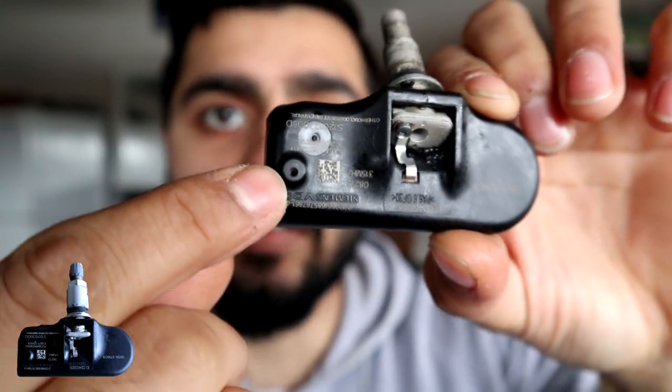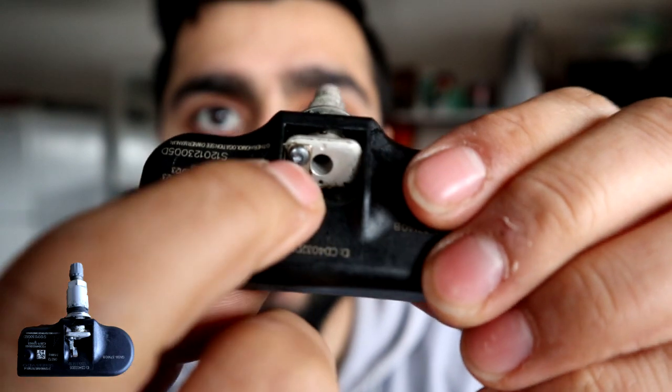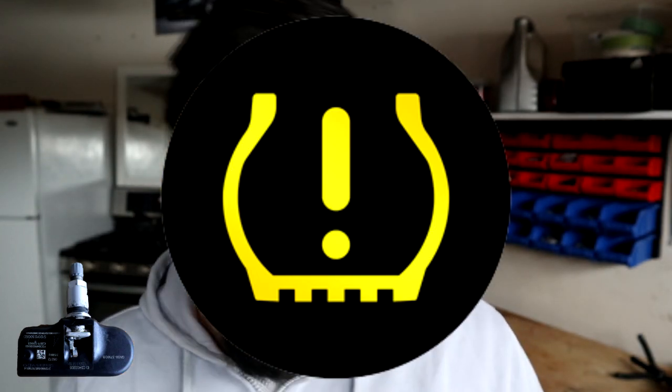This can directly measure the pressure in your tires. The air re-enters back into this hole. You see the stem — that's an antenna. The sensor is connected to the antenna, and it sends a signal to your car. Your car has a receiver that picks up the signal, it's hooked up to your dash, and that's how it alerts you the driver if your tires may be under or over-inflated.